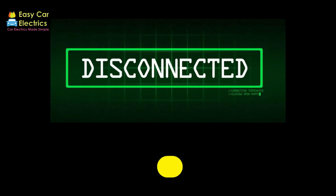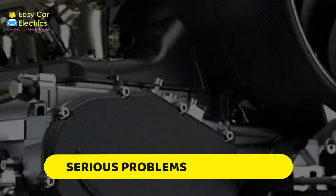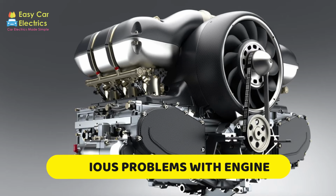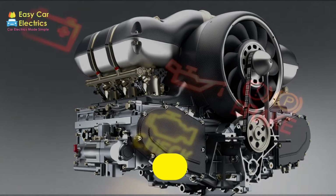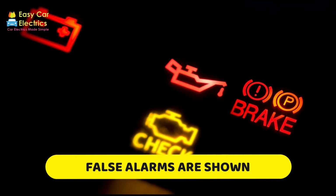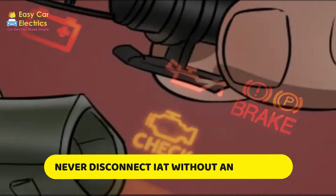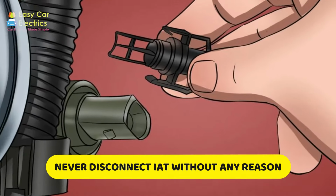of problems in your vehicle. The engine could run rough, stall, experience poor acceleration, and have random surges of power. Additionally, the check engine light may turn on and the engine may idle erratically. It is important to never disconnect an IAT sensor unless it is being replaced by another.